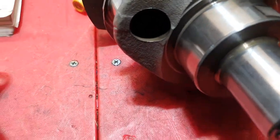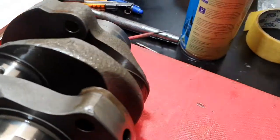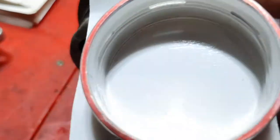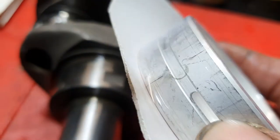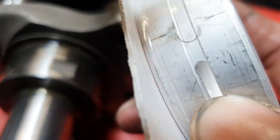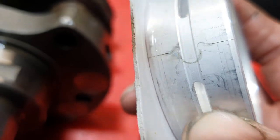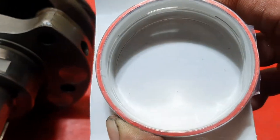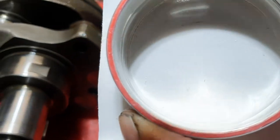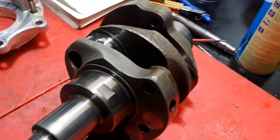When you get the main bearing it comes in a little packet like this. It's got the holes — the later ones have got these slots in them, which are great. At the back you can see the channel where the oil runs, and right there is the jigsaw puzzle joint. They're quite hard steel shells and quite soft inside; they're very easy to mark when putting in. If you're not careful you will scratch up the surface and cause yourself some grief.